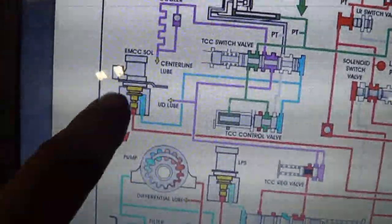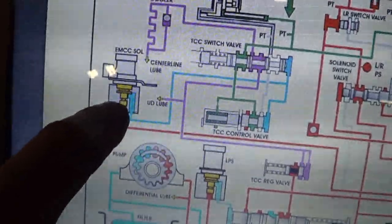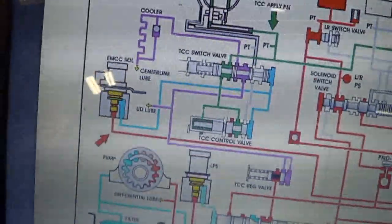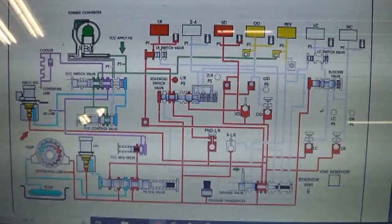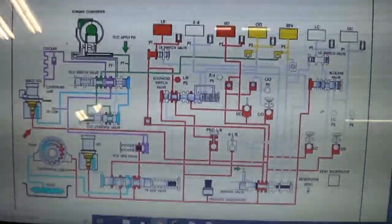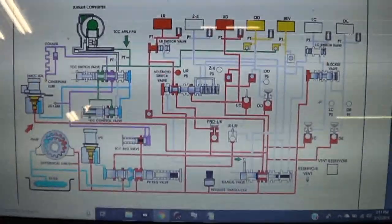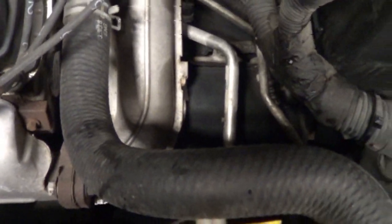The reason this car is malfunctioning is because the solenoid is sticking. There's a little valve inside the solenoid, and that valve is sticking in the on position, allowing pressure to stroke these valves when it's not supposed to. I'm going to call this customer and recommend a torque converter clutch solenoid replacement. We'll drop the pan and inspect for any excessive metal indicating transmission failure. Hopefully the torque converter clutch solenoid will fix it. This might be a good how-to for someone to watch, so let's get started.